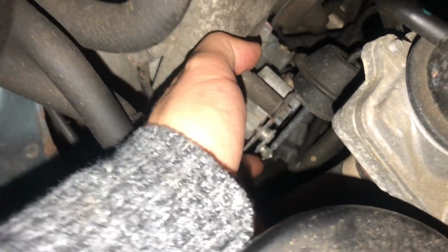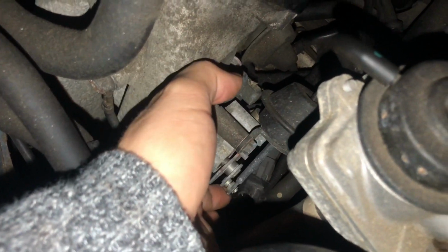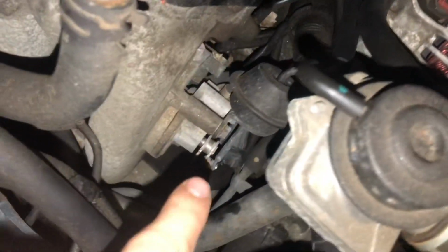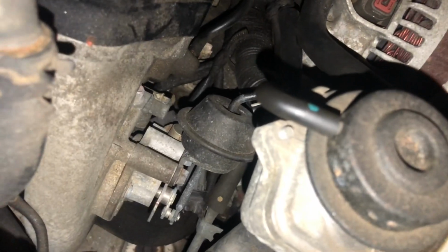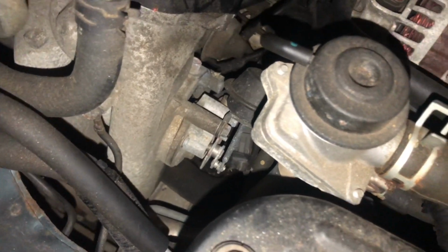See, this is the thing, the SSV controls. It's that second solenoid. It controls it, and the solenoid is actually over there. It's currently disconnected, guys. There's no SSV in there right now. Seriously, there is not. So in order to open up the intake, this is what I'm doing. And I did test this with a vacuum hose. That vacuum thing works really well. It opens things up, and because the intake does open up, that means there's no carbon buildup, which is good.